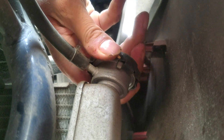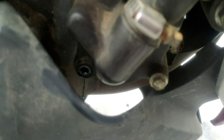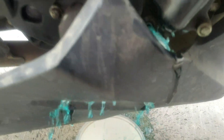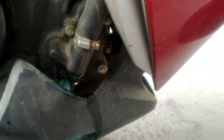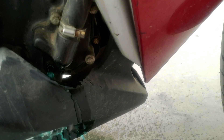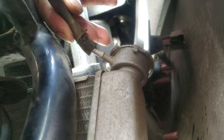I'm gonna place it right there. Now let's open the radiator cap and get ready to witness the fountain which is gonna happen any second now. The container is kind of useless because the engine fairing is blocking the entire flow of the coolant. The coolant is actually relatively old as the bike was sitting for about three years, so that's why I'm changing and replacing it, and also doing the cleaning. I'm gonna share the cleaning process as well.